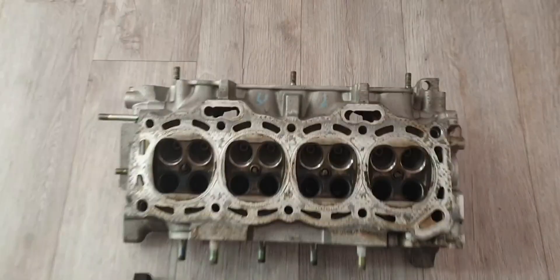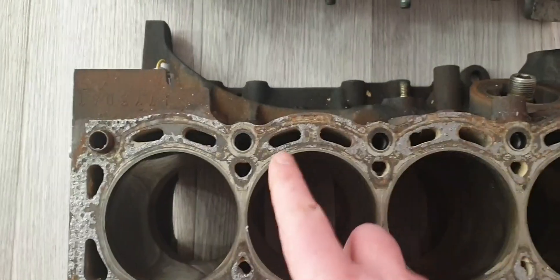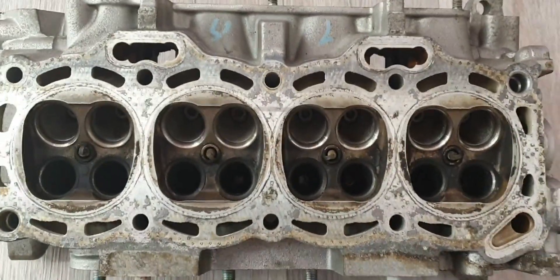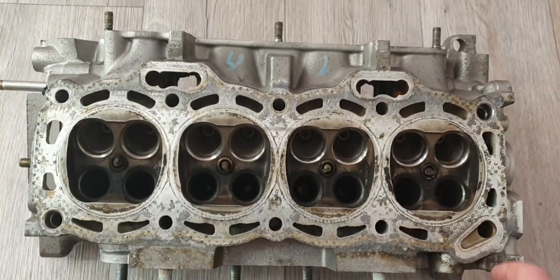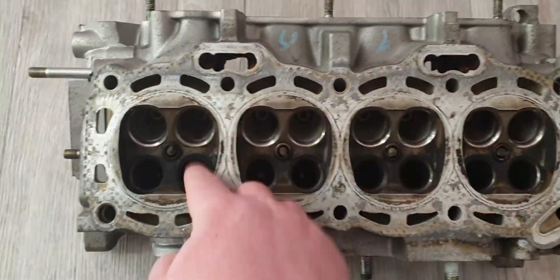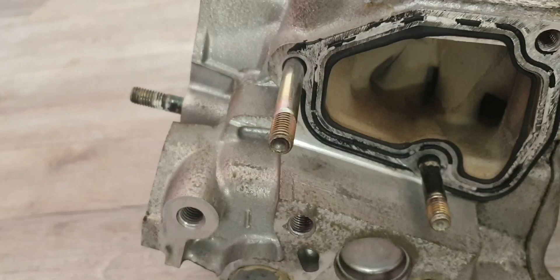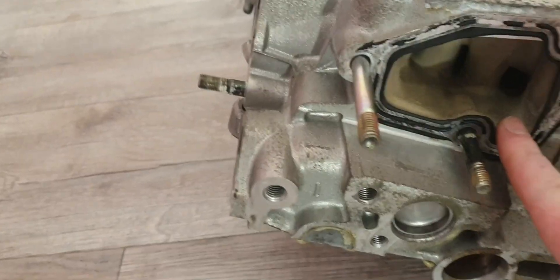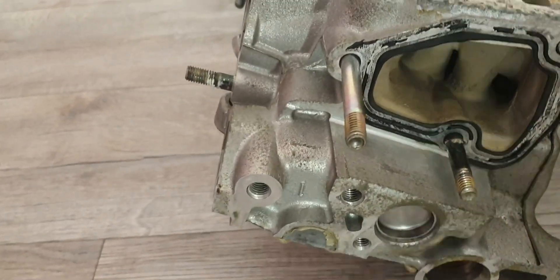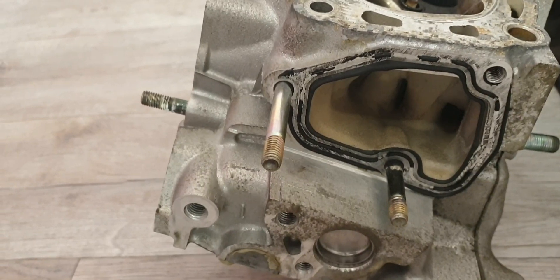You can see on the cylinder head these galleries all match these ones, and the water will proceed to go through the engine block and then into the cylinder head to keep it cool. Basically they're all flowing and they will come out over here. I suspect it's the block and then into the head and then out through the thermostat — here's the big sort of exit point for the water — but maybe you guys can correct me; perhaps it does flow head to block first.